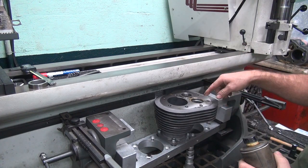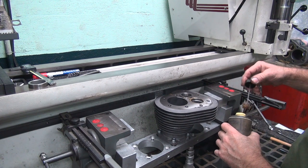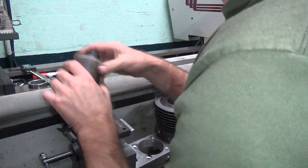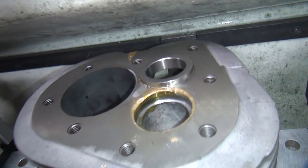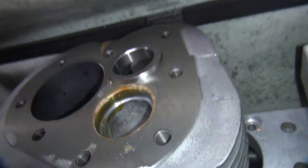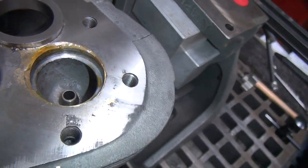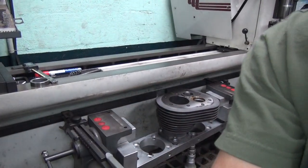Now this one is more even because the brass is all cut away or not filled in like the other seat was. It'll be almost even. It's basically giving me a big chamfer going in. See how the brass is not filled in right through here? So that'll make the seat start a lot easier, hopefully. The only disadvantage is it's really, really thin right here, so as long as this doesn't go underneath, we'll be fine. If it goes underneath, we're screwed. That would be a big problem.